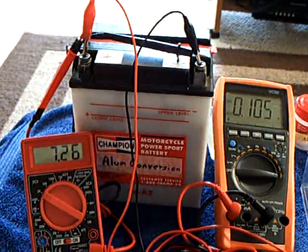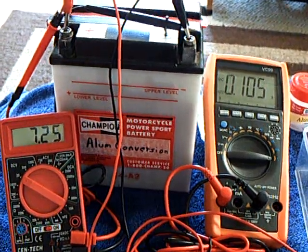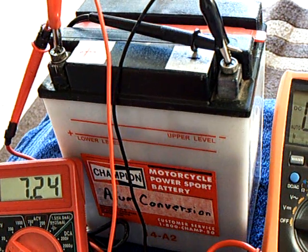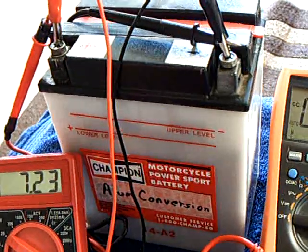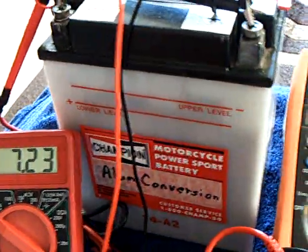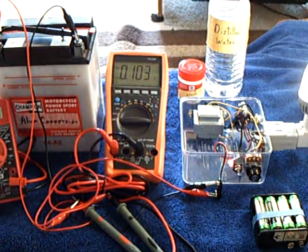Anyway, this was my little conversion of the motorcycle battery over to the alum and distilled water. I will say one more time: do not expect to get a 12-volt lead-acid battery, 14-amp-per-hour situation when you do this. This is going to be a different situation — it's not a bad thing, it's just different. Everybody's asking why would you want to do it, what are the advantages? To me, I don't have acid in it anymore. It's a rather benign electrolyte, and I don't think I'm going to have a sulfation problem. Plus it charges up fast off of a very small solar panel. Anyway, that's my latest on this project. I hope you other guys are coming along with it good. Thanks for watching.